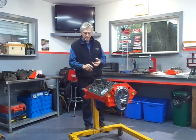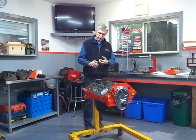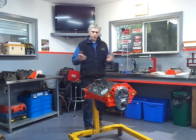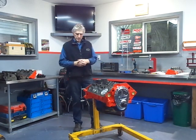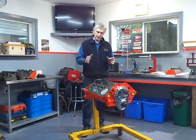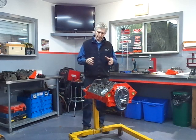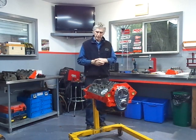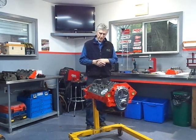I should mention on the paint — I use high temperature epoxy primer as a base coat and then of course Chevrolet orange, or whatever color is appropriate. I find that the high temperature epoxy primer — not easy to find right now — but it creates a really nice surface for the paint to stick to.